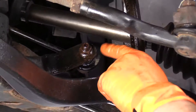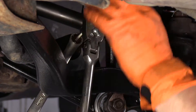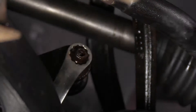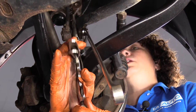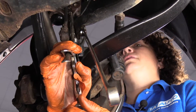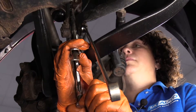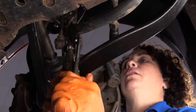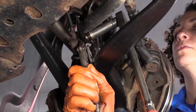That's spinning in place, so now I'm ready to put my ratchet wrench on there with a 5-millimeter Allen head socket. When that happens, we're going to get a pair of locking pliers and lock onto that little steel ridge on the back of the sway bar link. Hopefully get these to lock on that little steel ridge that's in there. I'm going to put that socket back on because now I have the freedom of the socket and the ratchet. Now it's working, so we're going to back that all the way off.